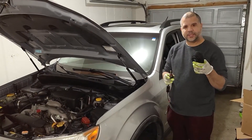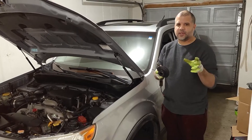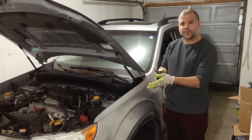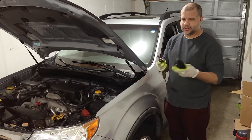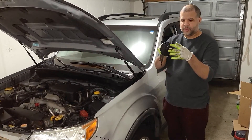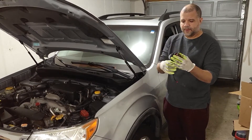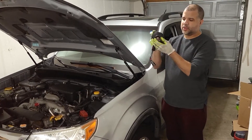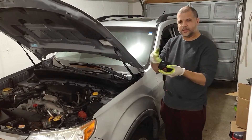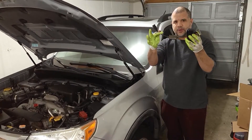A good reason for having the rubber LED covers is that once you replace your factory halogen bulbs, the factory dust cover has to come off, which means the headlight housing will be exposed to water condensation and elements from nature. So once you get one of these with the LED bulb kit, you put the bulb in this way, make sure it's nice and snug, and then this end goes on the headlight side to make a nice seal so condensation, water, and dust won't get in. The connector part goes into the car at the end of the installation.